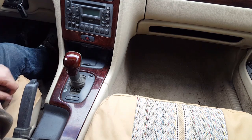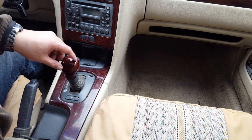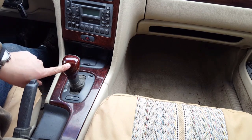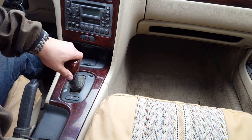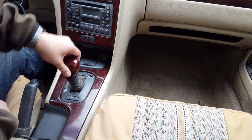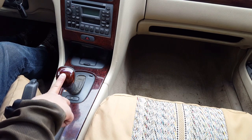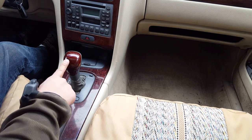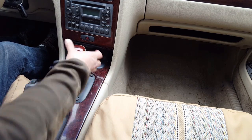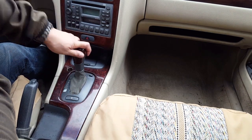From here, the shift knob should not move beyond drive unless you're pushing the button. Repeat the test in third gear — or fourth if you have a five-speed — it will not go further down unless the button's pushed, but it will go all the way back up to neutral. Going into second — or third on a five-speed — it should go straight up to neutral but not any further down than second. In low range there's nowhere further to go, but it should be able to go to second, third, drive, and neutral. Everything's working, the button has nice firm spring pressure, and it's no longer getting stuck or jamming. From reverse, push the button and it'll go into park and lock right in.